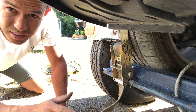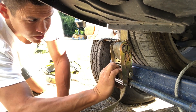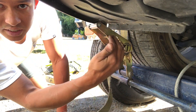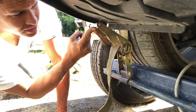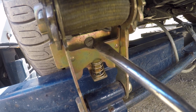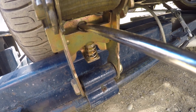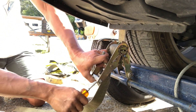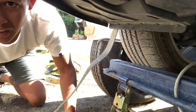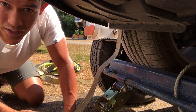To release the tire strap when you're ready to unload, pull down on the release mechanism and open the jaws up. To release the tension, the ratchet needs to be fully extended, but my car model blocks this from happening — which is where a flathead screwdriver comes in. Inside the ratchet mechanism there's a tiny hole; leverage the screwdriver with that hole and push down, then you can open it up and take the strap out. Always close the ratchet back up so if you're towing the dolly empty, it's not dragging on the ground.